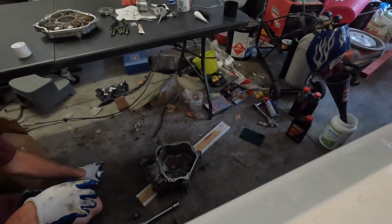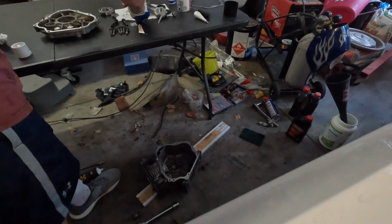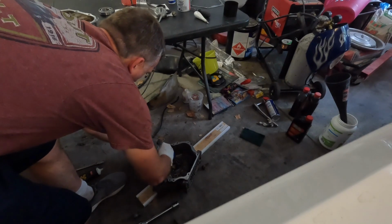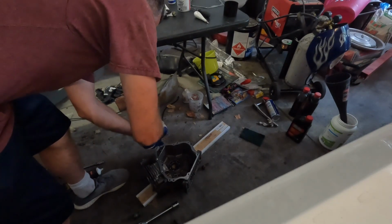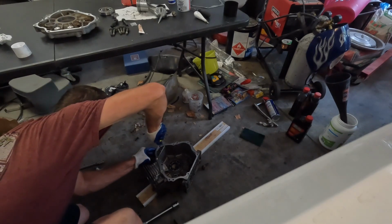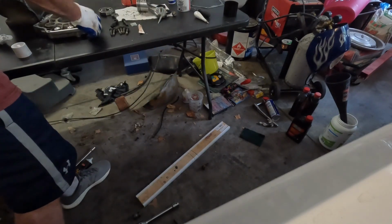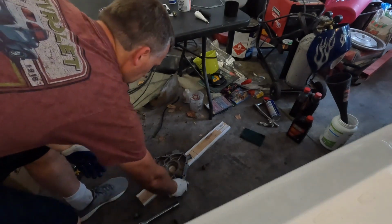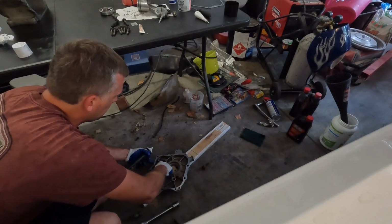Should be good. Okay, so that's the crankcase. While we have the crankcase out, we're also going to put the little vent cover, which goes right on like so. Right now just a Phillips head screwdriver. Okay, so now that's in there. Crankcase is done. Now we have left to do the crankcase cover. Again, we'll lube the galleries where they all go.